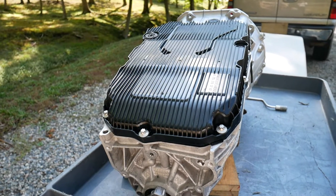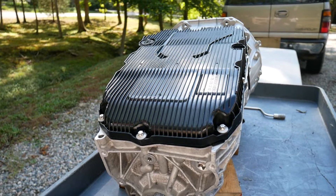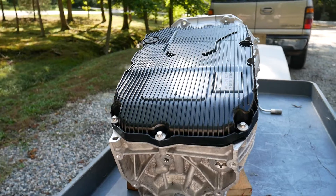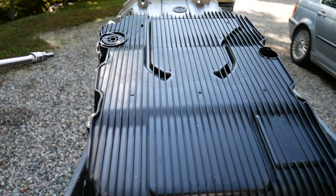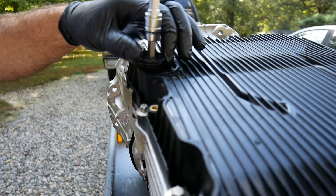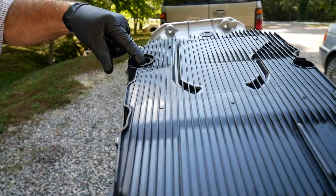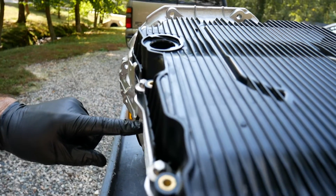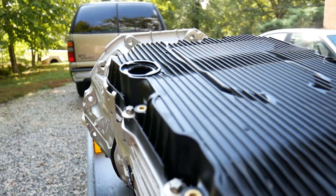Here we have the 9G-Tronic with the plastic oil pan. All fluid has been carefully drained and the transmission has actually been disassembled several times, so it will be dry inside. With this plastic oil pan, the two filters are integrated within it, along with a very clever drain plug — simply a quarter turn opens it. There's also a standpipe with two positions: a fill position to define the fluid level, and a drain position to drain the pan for service.